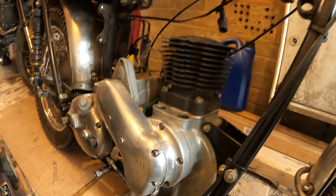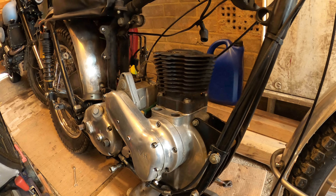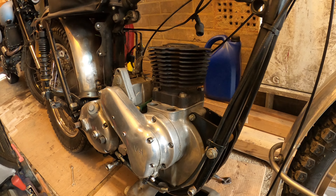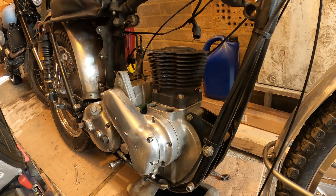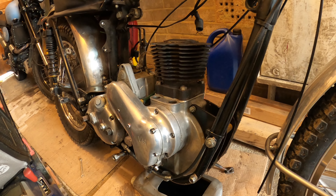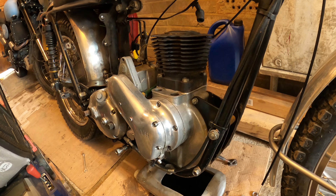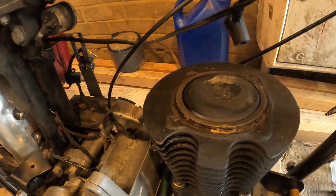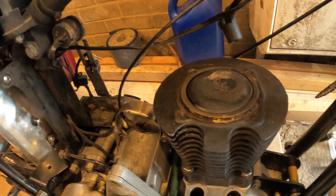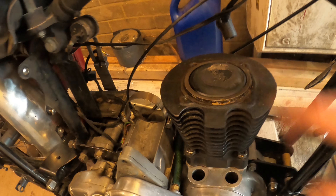Before I took this for its last run I decided to give it a full speed test, so I put in the biggest main jet I had — a 250. On the way back from my breakfast meeting my wife clocked me at 92 miles an hour before we ran out of road. Stripping the engine down now, it was running very rich and a bit sooty, so maybe I could have got another mile an hour out of it with a 230 main jet.